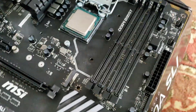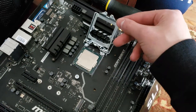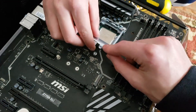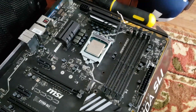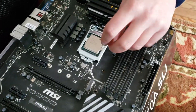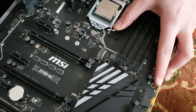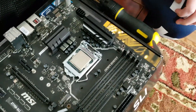This is the scariest part of building a computer. You've got to take this piece of metal and put it down, so it's behind the screw, and then close this bar down — put it down to how it was. I say this is scary because you have to apply a lot of force and you're going to think you're breaking the processor, but you're not. Perfect! Was that sketchy? Didn't feel that bad, honestly.